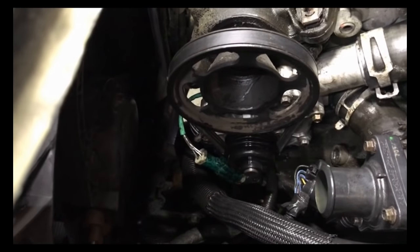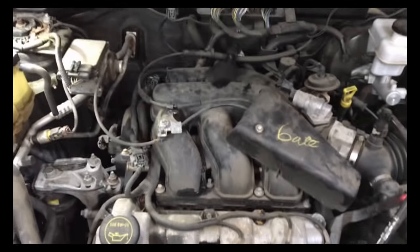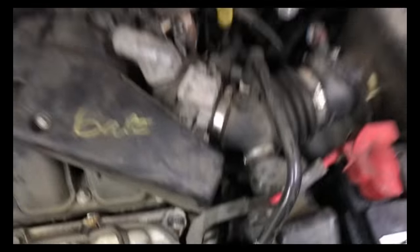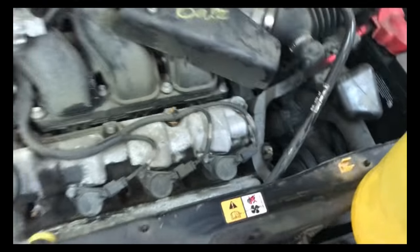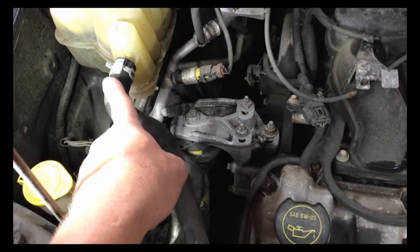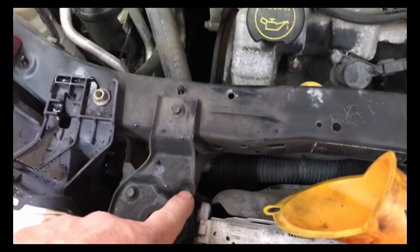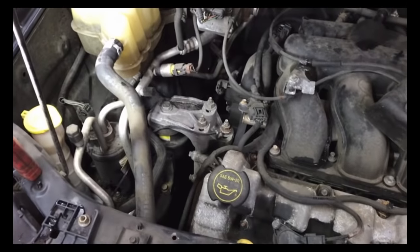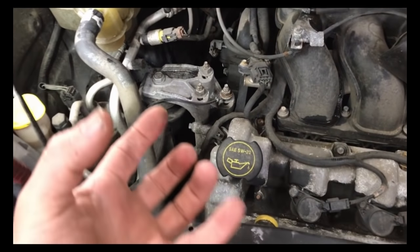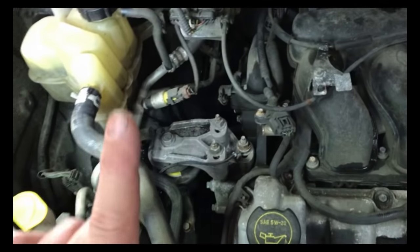You're going to need two people to put the belt on — it's very dangerous, so be very careful. We got the Escape all back together. Here it is running — water pump spinning, belt's on, belt's all lined up. Now with this car, since all the thermostat is external and those hoses are external, it's very hard to fill up. So what we ended up doing is we filled the bottle up as much as we could. Then what I usually do is I take this hose off, put a funnel in it — this hose goes to the top of the radiator on this side — and we slowly fill the radiator up with coolant with the car off. It took the rest of the coolant real slow, then finally it stopped burping and this level started to come up in the bottle, and then I knew that we were full. I put this hose back on with the cap on and got it running. This one looks like it is done.